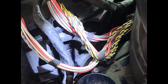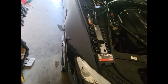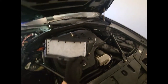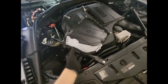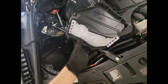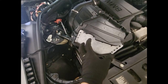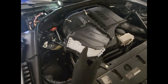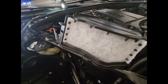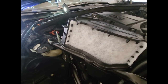It's all destroyed — let me show you what it's supposed to look like. This fabric is really soft and it can come off easily. When the blower is on it sucks air, but it ends up sucking leaves too, which causes it to rip. The leaves go inside, and if you let it stay like that for a while the motor bearing will go out and you'll have to replace the motor.